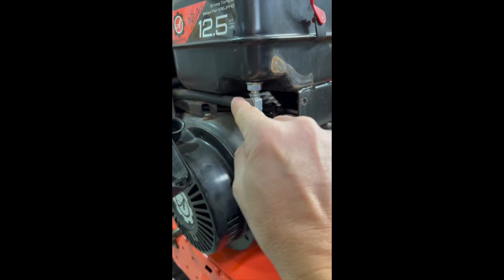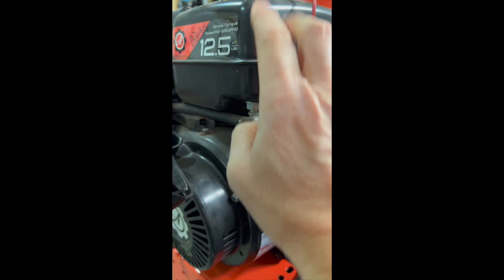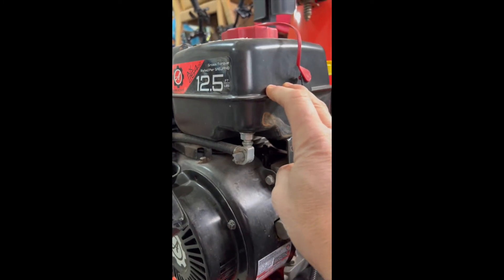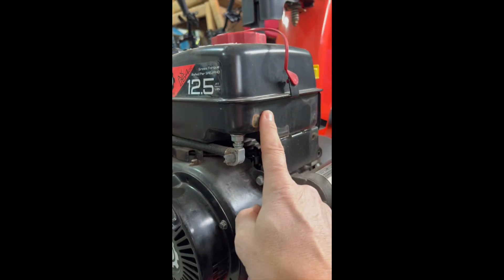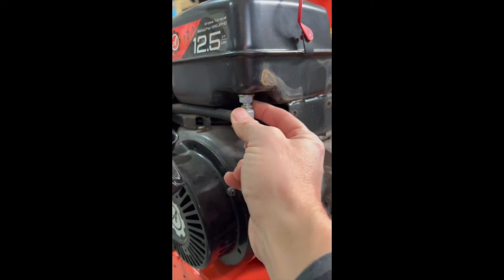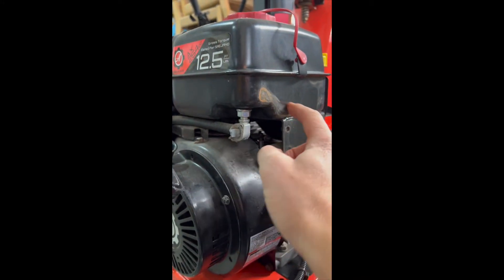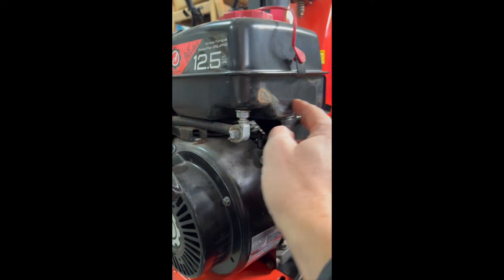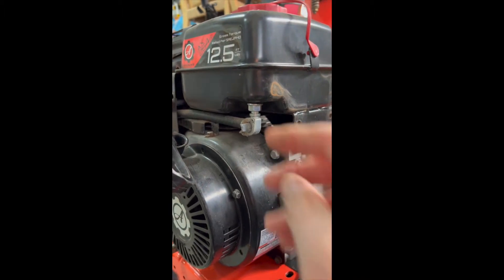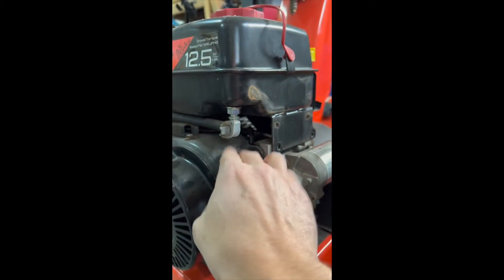So what you'll notice is this is going to be a T-valve — an on/off T-valve — and it goes into the fuel line here. I ran this until it's bone dry, hoping that will alleviate any fuel that comes flooding out when I disconnect it. You'll also notice this is on a riser, so if there is any fuel, hopefully it'll be down in the lower part of the fuel cell. Either way, be prepared that this is probably going to drip some fuel — so get your paper towels ready.